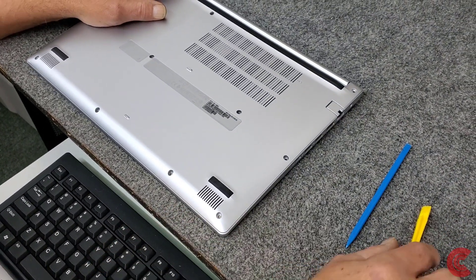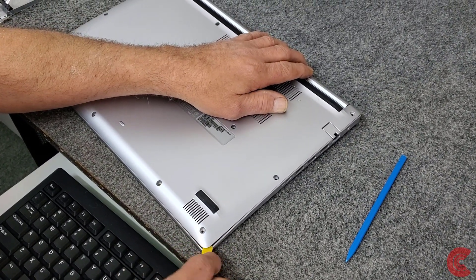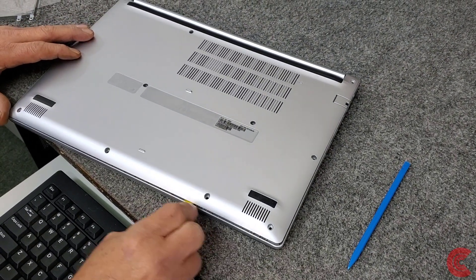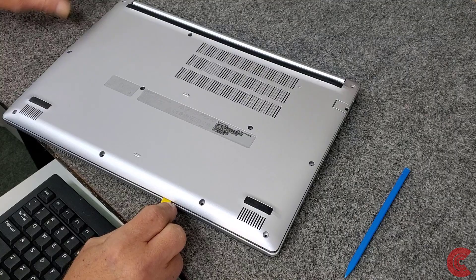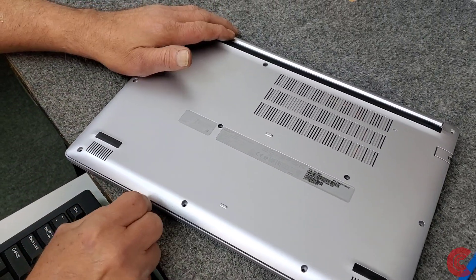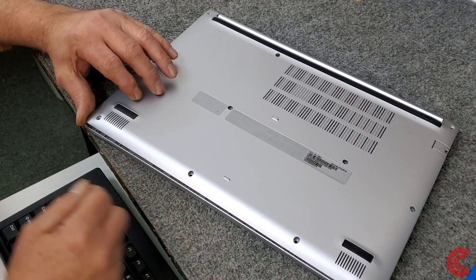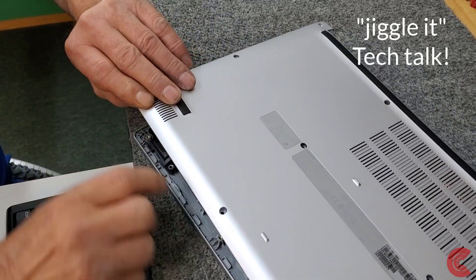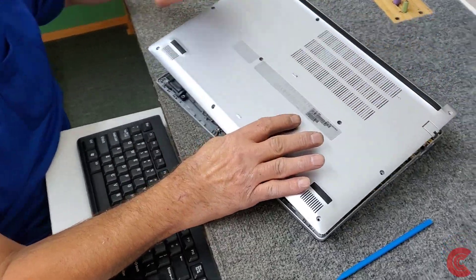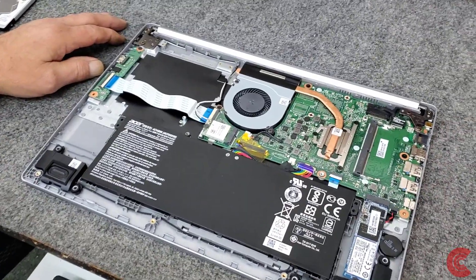It's not too difficult — pick a corner or someplace and start, because we've got to break it away from the seam right here. Sometimes you can get your little spudger in there. There we go, get it started just like that, just kind of working along the front. These ones come off pretty easy. Just got to be careful how far you go in — you don't want to poke a speaker because there are speakers right there. Once you get it started you can just jiggle it and it pops loose. Keep an eye on the Ethernet port back there.